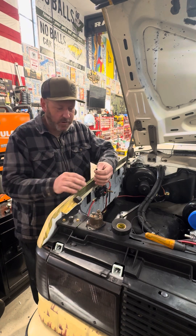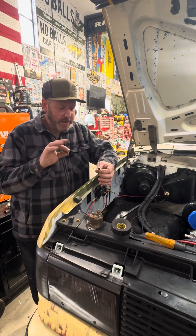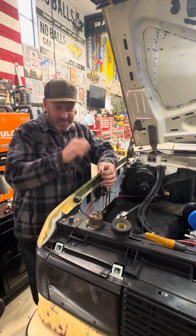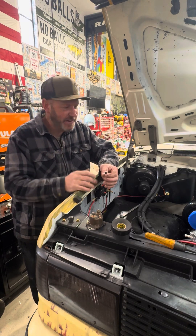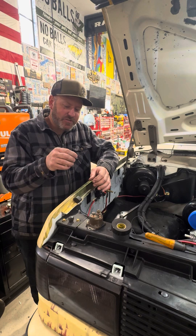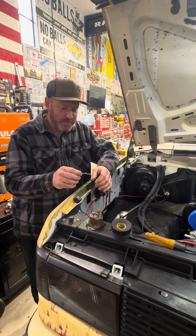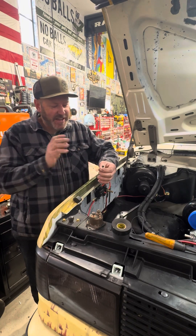If you're doing something higher current — like me in high school, we used to call them parking lights, pimping lights, 140 years ago — I thought I was real clever because I hooked my parking lights up to my ignition. The problem was if I left my lights on, the engine wouldn't shut off. That's when I learned about diodes. I went to RadioShack and bought one that was milliamps — way too small — and it worked for about five minutes until it melted and fell in half, because it was way too small for running a bunch of incandescent light bulbs.